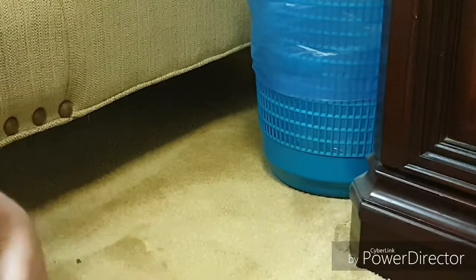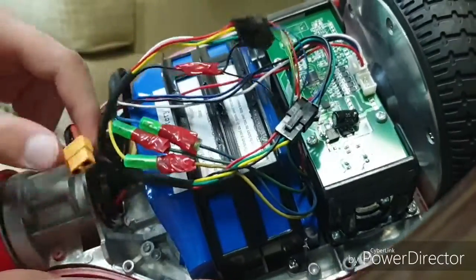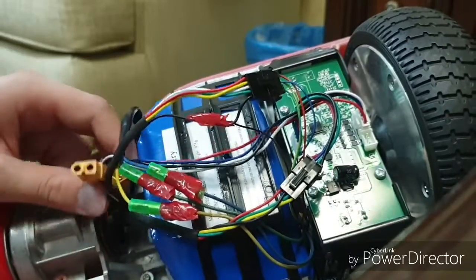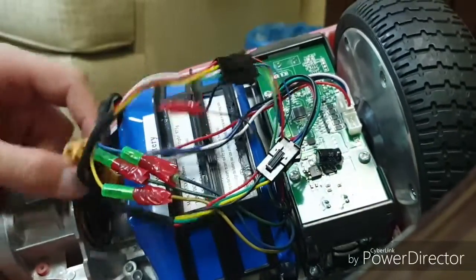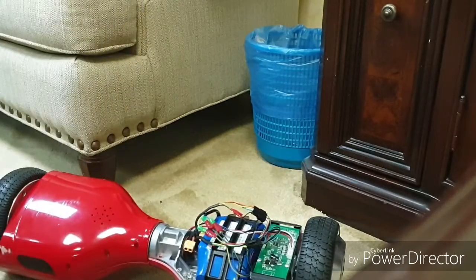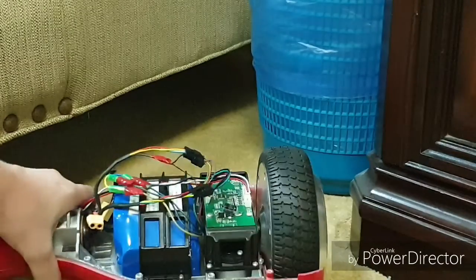Let me show you where the harness for the battery is. If you can see these two yellow connectors — those are the harness for the battery. In my case they are disconnected; in your case you should disconnect them, which will discharge the battery from the system. Then continue unscrewing.